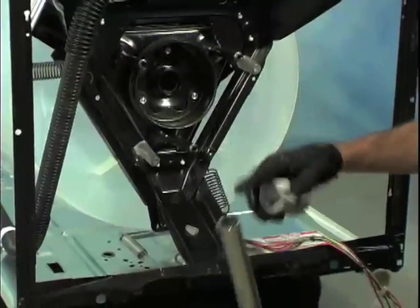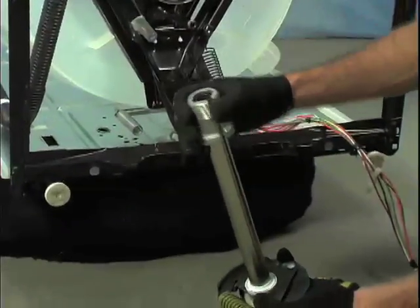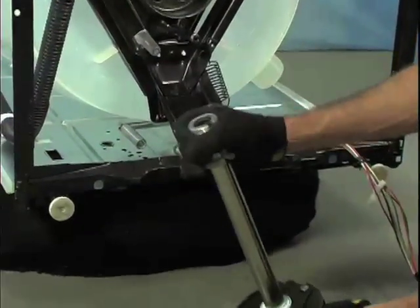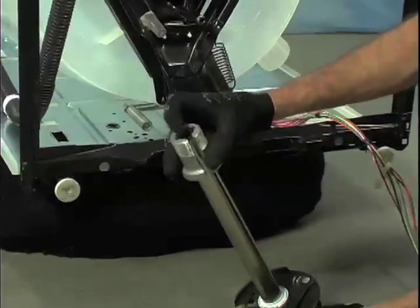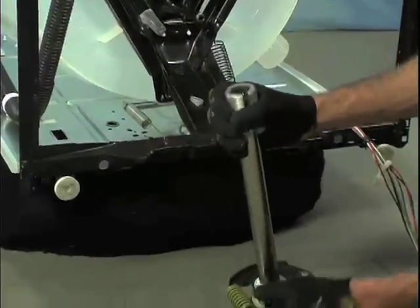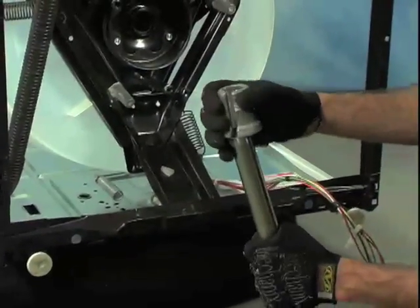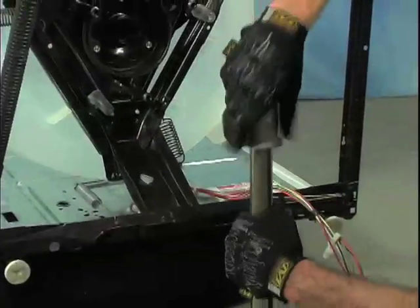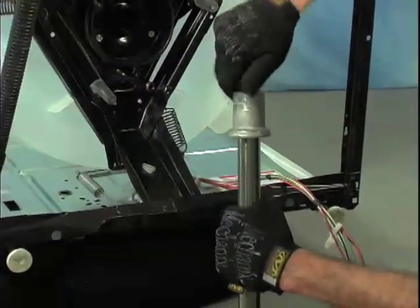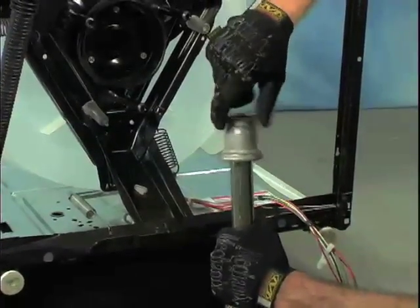Now back to the drive tube and hub. The hub rests on top of the drive tube and is kept in alignment with two notches that lock the hub into place, preventing slip. Over time, slipping during spin and braking will cause these notches to become ground down and allow the tub to hop or bump to a stop whenever the brake is activated — producing a loud thumping noise when the lid is open. You don't need to pull the transmission to replace the hub; simply pull the inner tub and replace.